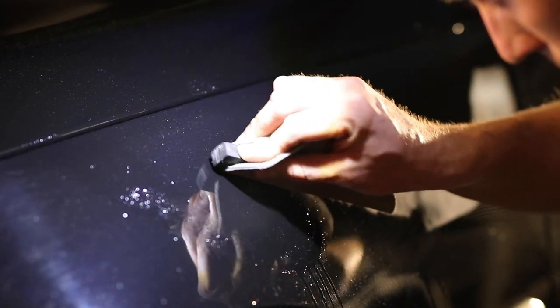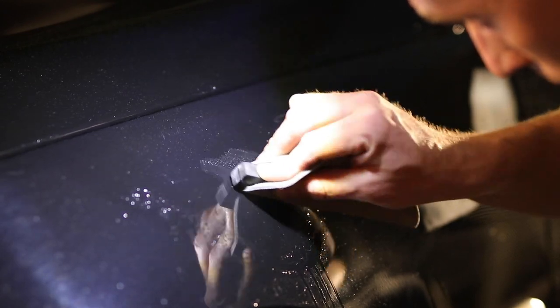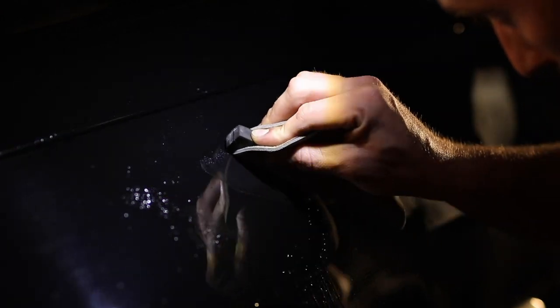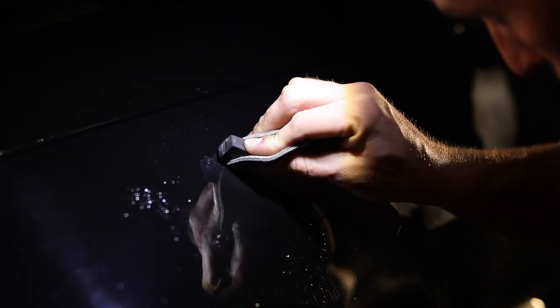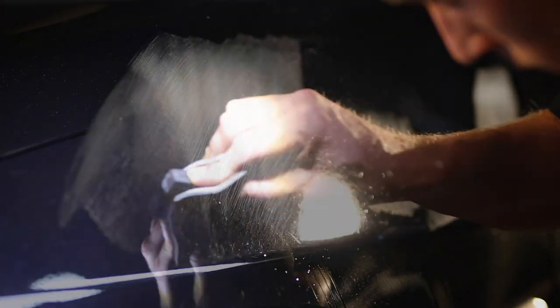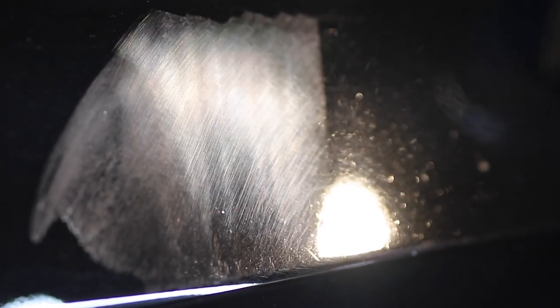You do want to hear the actual sanding. This is on a curved panel and I may not know exactly what I'm doing, but you're always wanting to sand to improve, not remove. You're going to see clear coat that I've removed right there, so I'm just going to spot sand around the vehicle, try not to be too aggressive, and not going to use any more aggressive sandpaper than that. Rounding the edge — even if it doesn't come out once I compound and polish it out — it'll be perfectly acceptable for a showroom shine.